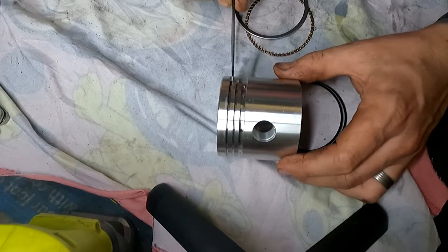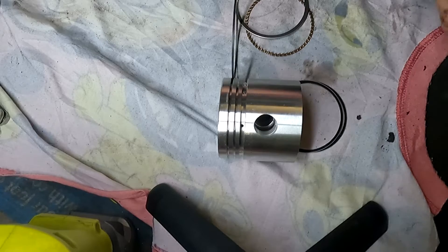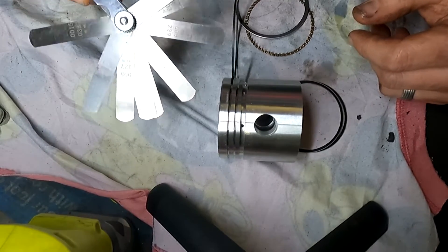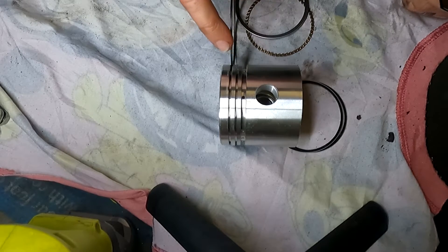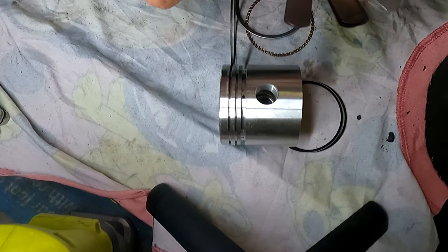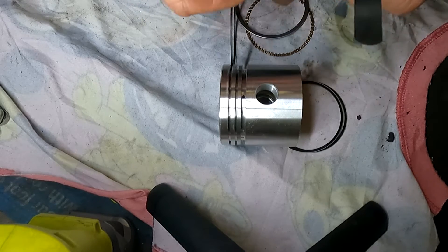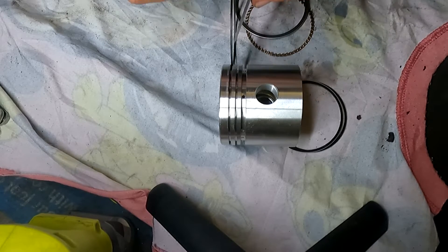We're going to get the ring and stick it inside the piston ring groove just like that, so it's now supporting itself. What we need to do next is get a set of feeler gauges and confirm our measurement. For the top two rings we're going to be measuring the gap between the piston ring and the side of the piston — the side clearance — and it's going to be between 2 and 4 thousandths of an inch. So let's start with the smallest number, which is 2 thou, and check the gap.